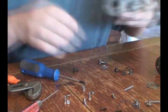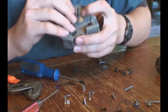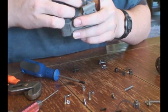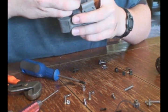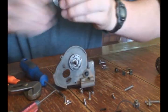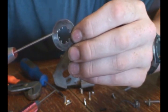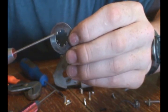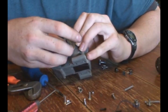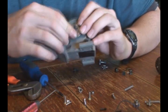Now you put your slipper plate on. Make sure it lines up with the smaller teeth — there are larger teeth and smaller teeth. Make sure the little pins in there line up with the smaller teeth, or else you'll have a lot of slop. And that's not good — that will break it more than the clutch will save it.